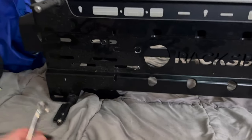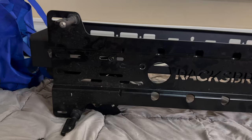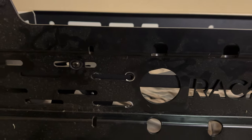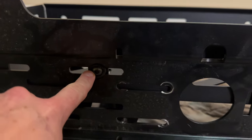Excuse the dirt on this bracket — this is used and I never cleaned it after I took it off of the Hammer Built side mount. I measured on both sides just to make sure I had it symmetrical, and you can see where the old mounts for the old bracket were on the Hammer Built. I took leftover button-head bolts from a JCR bumper kit and bought lock nuts, and I put some rubber washers in there to keep metal-on-metal contact off of it. It does bow a little bit as you tighten it, but just a little.